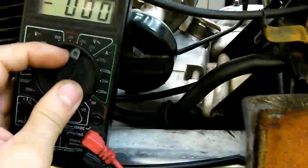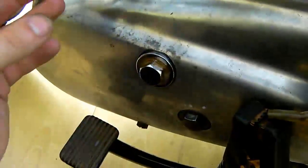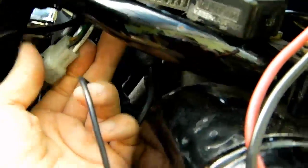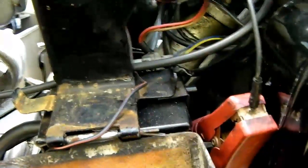I've only got a choice of 600 and 200 volts AC, so obviously put it on the 200 volt setting — that's how you check the output from the alternator. If it's putting out a lower voltage, you've got a problem with one of your windings, the alternator itself, the air gap, or something similar. The next step is to plug it back in and check your outputs, because you have an input into the reg rec and an output which goes to your battery terminals. You can either check that on the reg rec itself or touch a probe to the battery terminals.